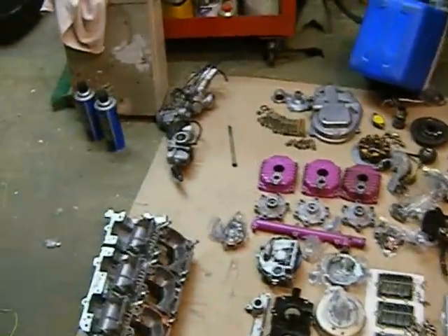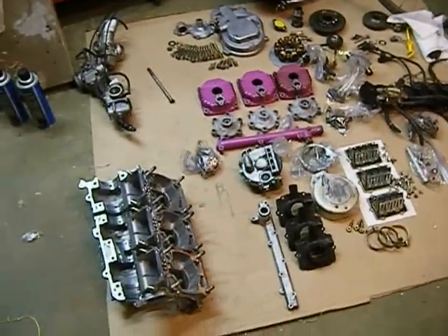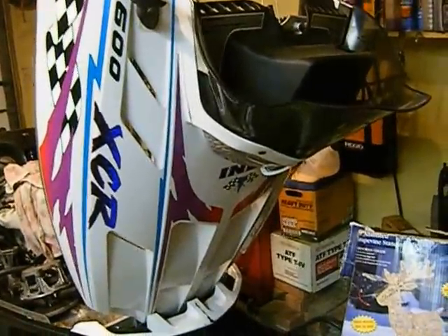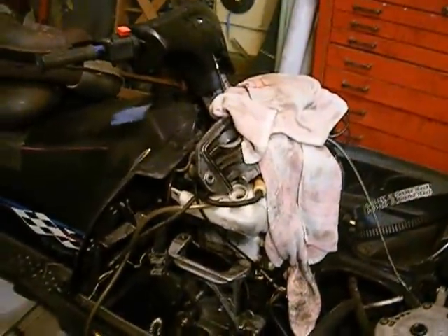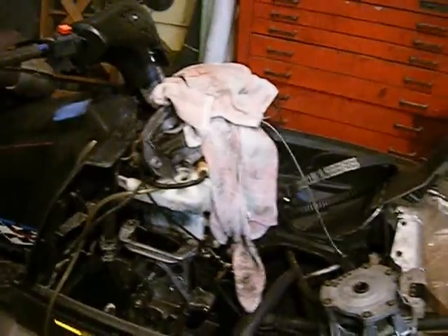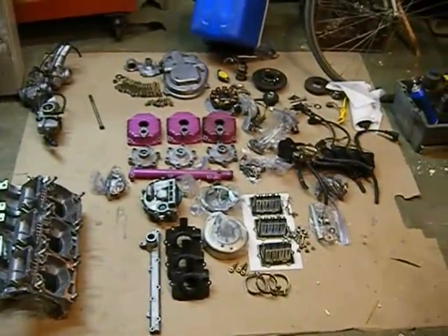The oil injection works fine, and I've always been a mix-my-oil-and-gas guy. One other reason: this sled has signs that it's been rolled. The windshield is Frankensteined, it's got some cracks in the cowl and plastic. That little oil tank went topsy-turvy, and when they go topsy-turvy you could get an air bubble in your oil line, and you're not oiling your engine at all. There go your crank bearings, and you start scuffing up your pistons — it comes apart really quickly.